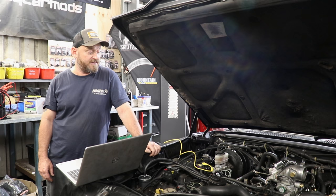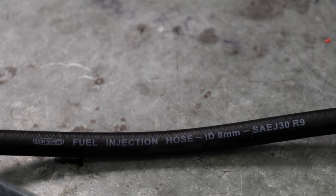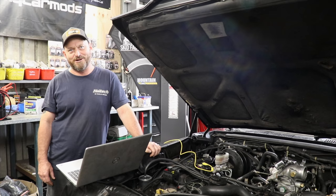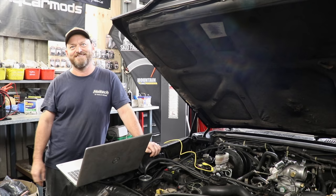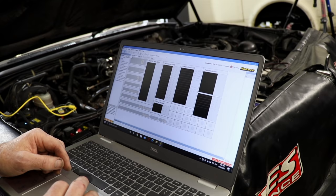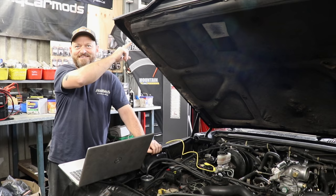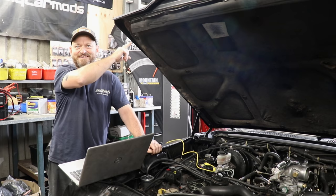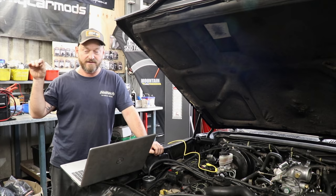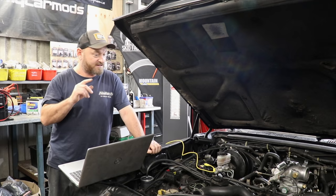Fuel pump's fitted. We've replaced the hoses with fuel injection line — new stuff. Remember that just because it says fuel hose doesn't mean it's fuel injection hose; it should have fuel injection written on it. Sometimes they put 'not for fuel injection' on the carby hose, which is confusing when they cut it off right where it says fuel injection. Make sure it's the right stuff — it is different pressure ratings. Now we're ready to configure the ECU. We have done a fairly detailed full episode on doing this way back in the VL build days — you'll find it here if Woody remembers to put it in. We're just going to do it pretty briefly with this one as it's a simple engine and a good example.